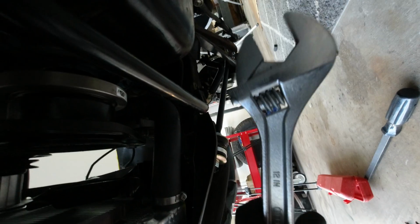I had to measure the original one, which was about 16 and a half inches to dead center on the first bolt on the bracket. So that's what I measured, and I brought it out. So I just sat here and adjusted it with one of these guys, but a smaller one. So now I've got to go test it out. It's back to stock spec, but we're going to take it to get aligned.